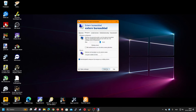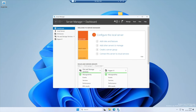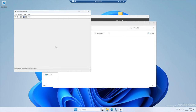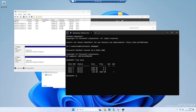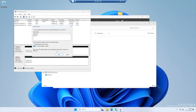So we're at the desktop now. It turns out one of the disks wasn't plugged in, so we should be able to have both of them up in Disk Management — and we do have two 2TB SSDs right there. Let's make some use of them and go into diskpart: list disk, select disk 0, clean it, select disk 1, clean that as well — so we don't have any partitions. Now we can initialize them both at the same time with GPT.